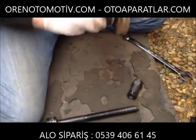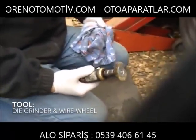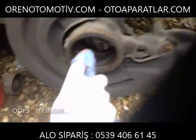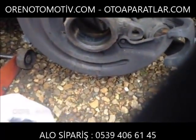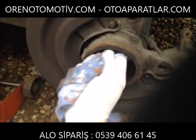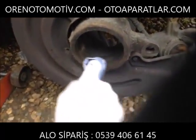One shot bearing. Ooh, that's noisy. What we're going to do is just clean out the aperture, remove any grease, dirt or otherwise that's in there. That will prevent the clips from going back. If you come around and have a look, you'll see there's this rebate along the inside here, which is important to keep clean, and also you need to clean it right round at the back to make certain that she goes all the way home. And also the tool sits in there in a rebate behind.